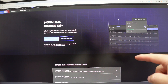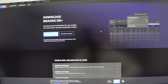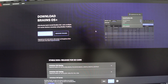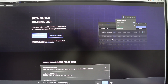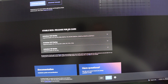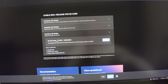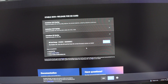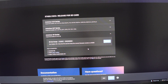So we're going to install BrainsOS on that S9 and actually crank down the watts to around 300 watts total. And then we're going to solo mine with it — 300 watts solo mining, I'm very eager to see what type of hash rate we can get. There's a Brains Toolbox you can check out to deploy Brains onto machines on your network, or you can do it via SD card. You pick what model — S9, S17, or S19 — and they have an SD card image kind of like Hive OS or Luxor where you can install the image right onto the SD card. If you guys want a video on this and you have some S9s sitting around, leave a comment down below and I can do a step-by-step guide.